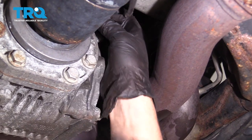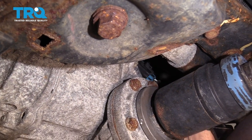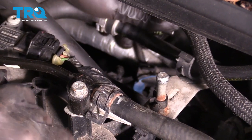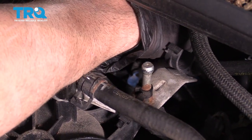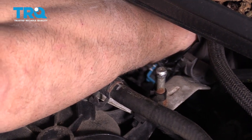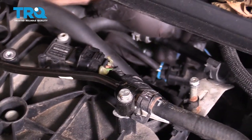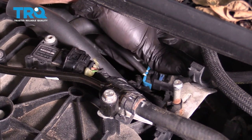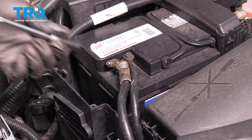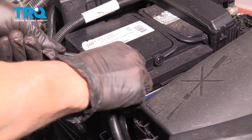Connect the O2 sensor — it's right above the differential. Reattach the lock, then take the connector from the back and connect it. You might have to fish the wire through if you didn't earlier. Connect it to the connector, add the little extra lock, and lock it in place. Then connect the negative battery terminal, snug it down, and make sure it's tight.